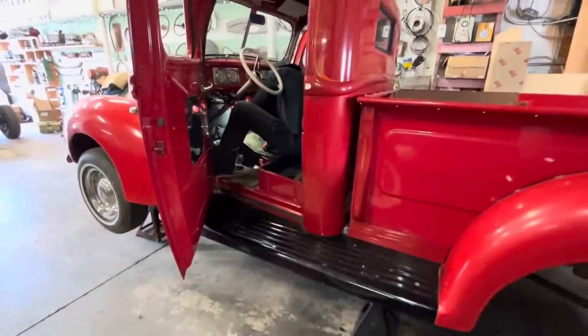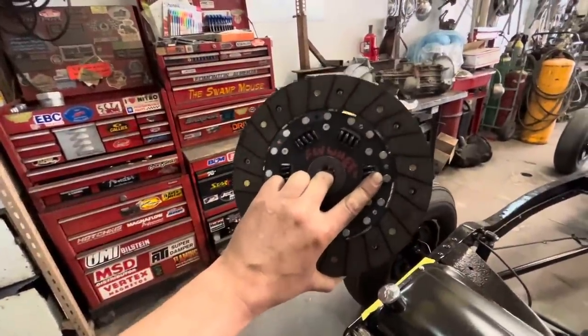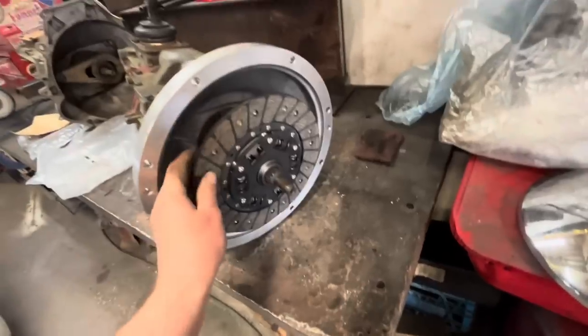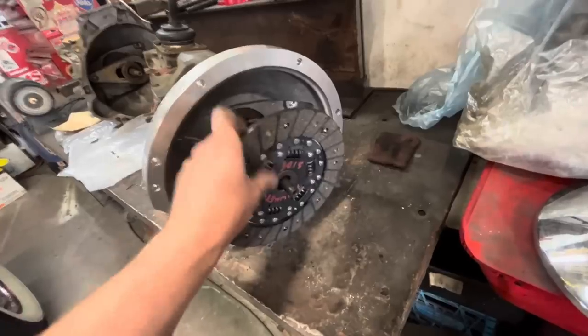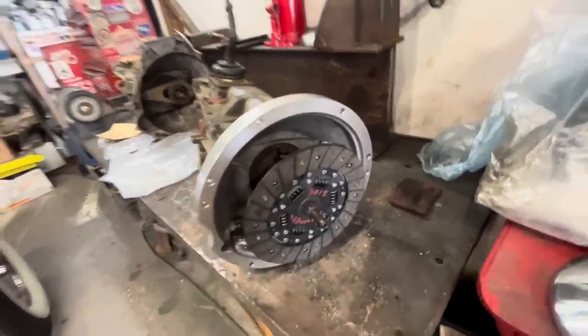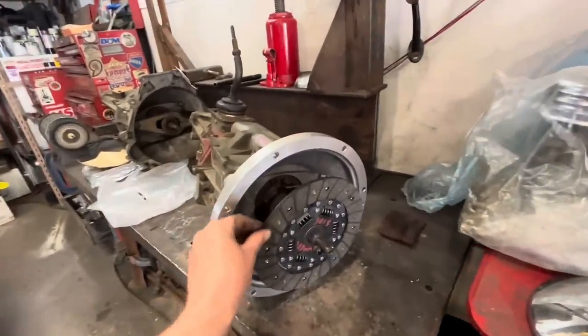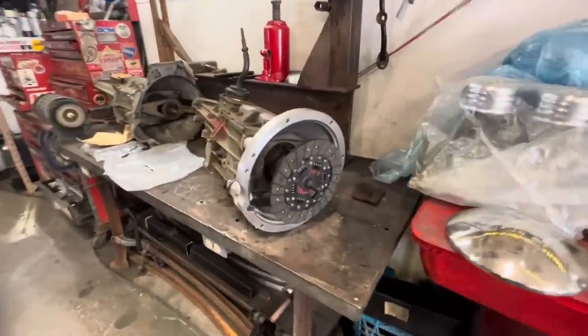So once the clutch is done, we'll do, speaking of the clutch, we had to get a different clutch disc. This is a 14 spline disc that will fit on there like that. Actually, it goes this way. And that's all we gotta do. You still use the flathead pressure plate. You just need this disc here, and easy peasy. Bob's your uncle. Actually, Bob was my dad.